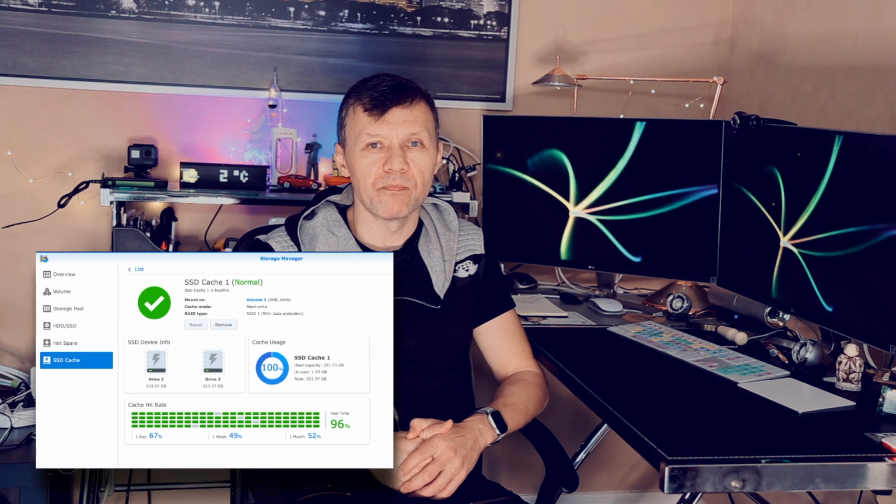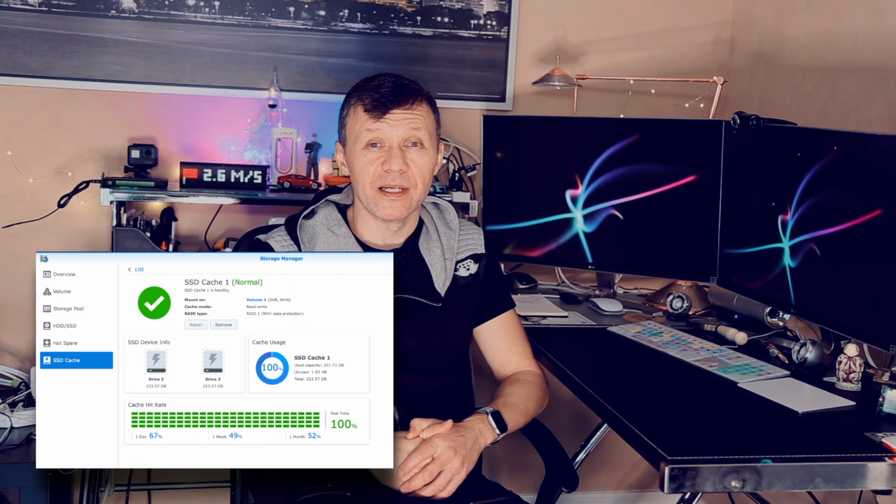Also, we're going to be doing some testing for the I/O throughput, which is also the main reason why you are configuring a 10 gigabit network. You need to make sure your network is supported, your storage is supported, and for that we'll do some testing and benchmarks to validate that 10 gig is actually driven by 10 gig. If you hit the limit of the throughput, that limit is actually from the end device and not your network, and that you can improve going forward, especially if you're using a NAS. Adding cache to the NAS is actually gonna help a lot to get your throughput higher and make your experience with a 10 gigabit network much more satisfying.